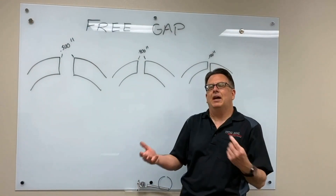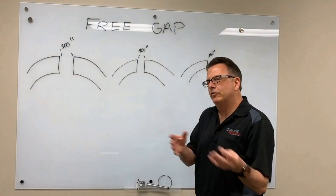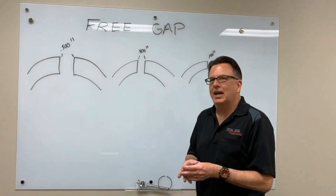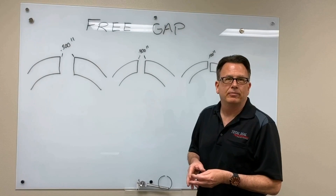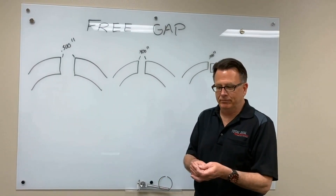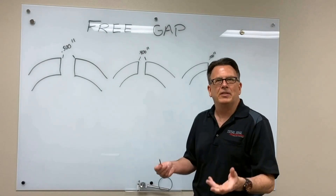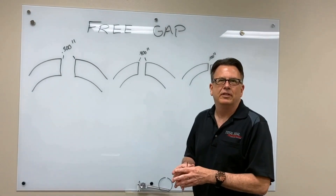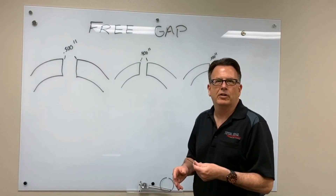How do we get there to start with? It's through those questions. We have to navigate all the different materials that rings are made out of. There's cast irons, there's ductile irons, there's hardened ductile irons, there's stainless steel, there's tool steel, there's even copper. It all depends on the application, and that comes down to temperature and pressures — different ring materials will handle different amounts of pressure.